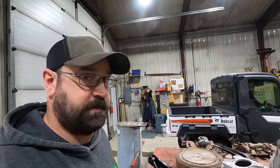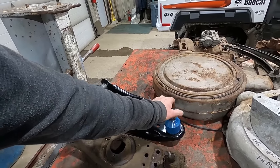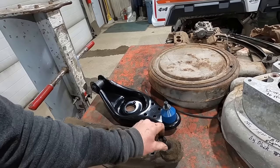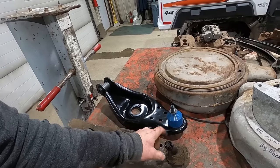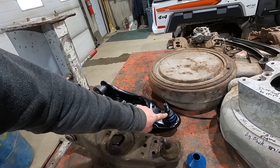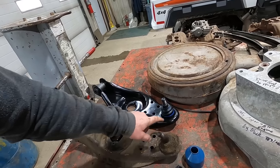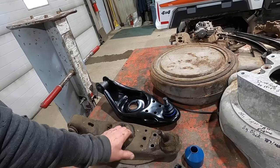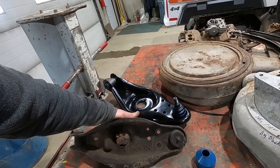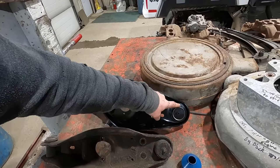Well, we got ourselves in a pickle. Imagine that. Can't believe everything on the internet. So, this castle nut, same thread as this castle nut. Diameter, everything, right? Great, grand, wonderful. No, the old taper is significantly larger on the 1-ton, as it should be, than it is on the old 1/2-ton. So I don't know what we're gonna do, because that's way bigger than that.